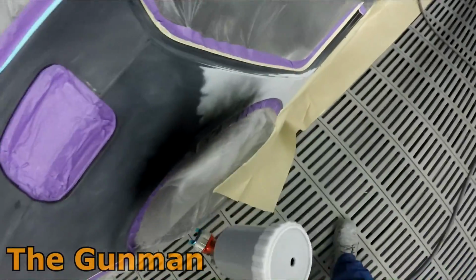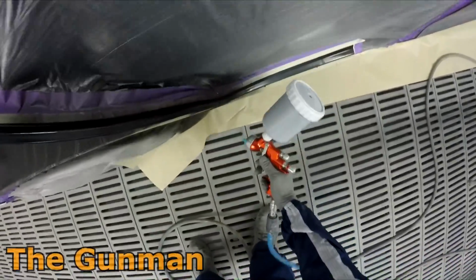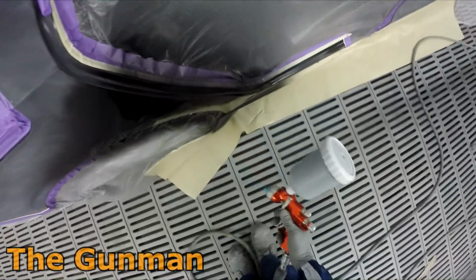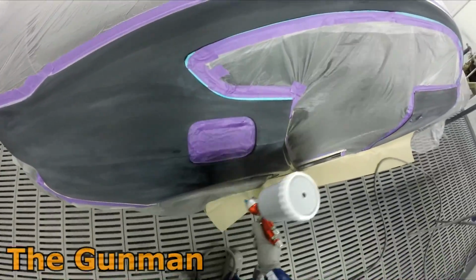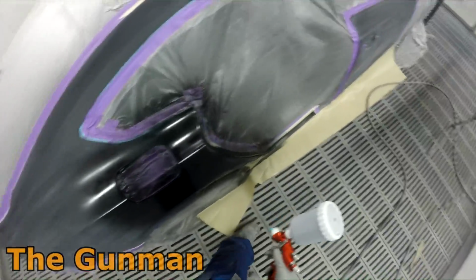Like when I was working in a waterborne shop, we used to just use a bit of the 1K aerosol primer, and that was fine. It did the purpose for little cut throughs and stuff like that. Anything that needed a bit more of a block, you just put some 2-pack primer on it, use the infrared lights, block it back, and continue on with the job.